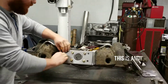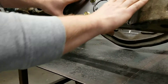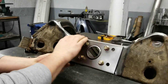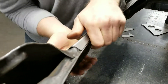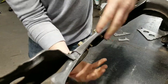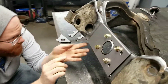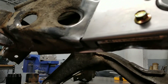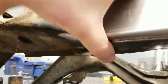The GK Tech kit also includes this rear differential support. This section is known to crack under hard launches — it's more of an S14 problem technically, but it can always help reinforcing the subframe here. We ran some bolts through to make sure and squeeze it extra tight so when we weld it, it's a perfect fit. You could even take your diff cover off and bolt it to there and that would do the same thing. We did have to grind just a touch off one section to get it to fit in between, but as with any mass production part, there's going to be little variances. So overall, very nice kit.